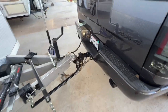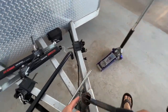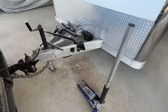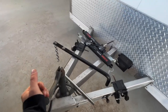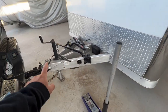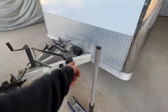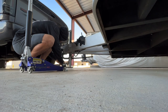Let me show you how I install these. Some guys use the hand crank, but my buddy told me he uses a floor jack, and once he told me that it seemed so much easier. Rather than sitting there trying to crank everything like crazy, I just put the weight distribution bar in and then use the floor jack to lift it up and hook it on. The bar goes in here until it clicks.